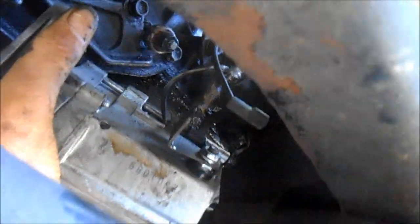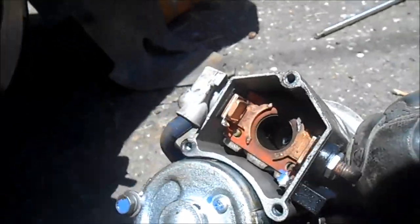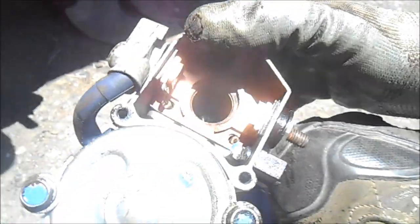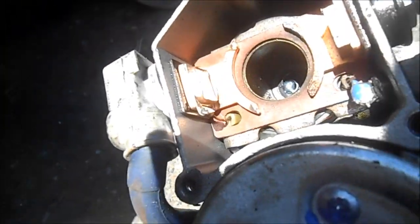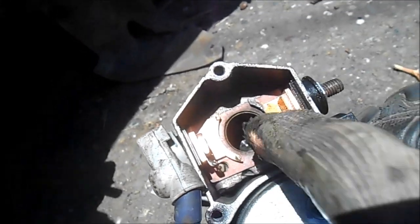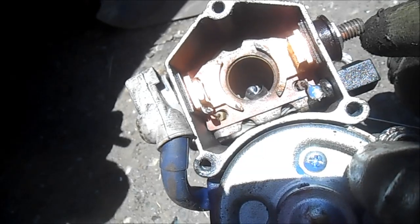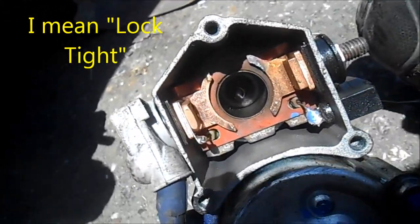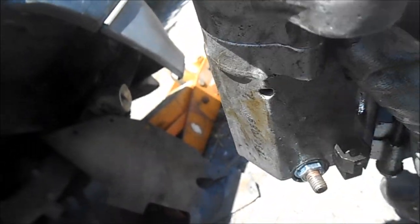I'm just pulling this thing out and we'll look at it. Apparently they didn't put any Loctite on these bolts — they're not stripped, they just eventually came loose, probably not torqued down to the right specifications. You can see inside there's a push rod or something that shorted out on the side — you can see the debris there. That's what I saw glowing when I was looking at the starter. I don't think the bolts got torqued down or had any anti-seize material on them.